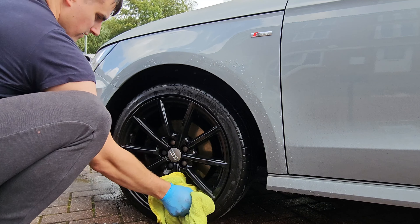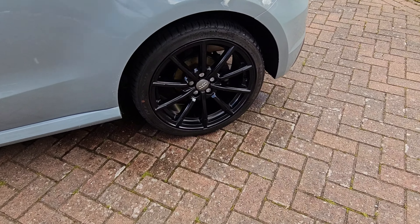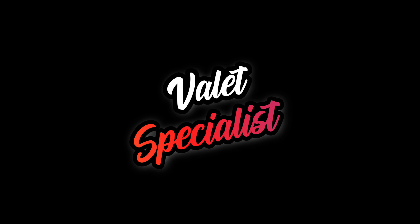There's a massive difference between one to three and one to ten or one to eight. At one to three it's extremely potent; at one to ten it's a bit more user-friendly. If you just spray it at one to three and rinse it off, it will probably knock off ninety-five percent of the brake dust without even touching the wheel. It's really effective.